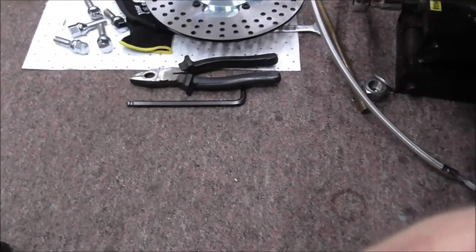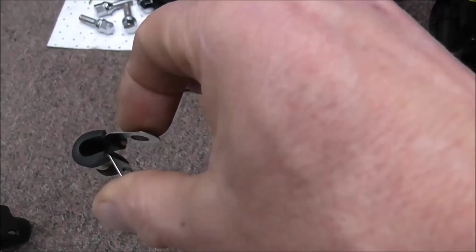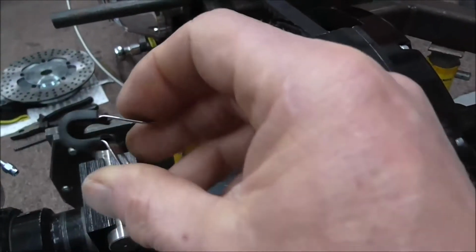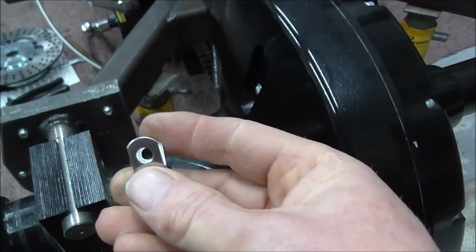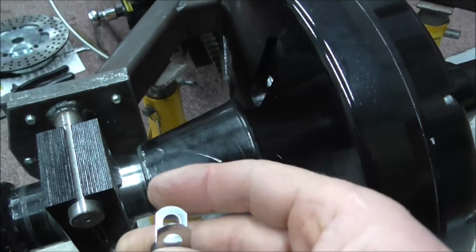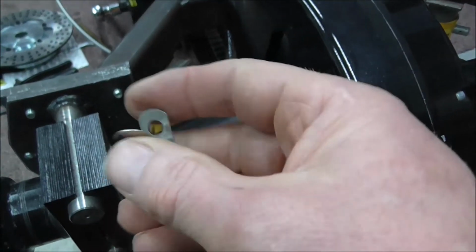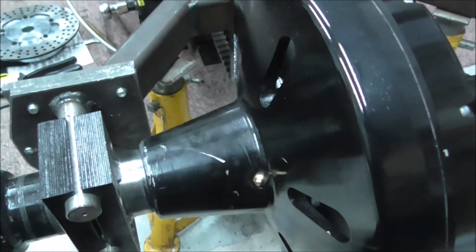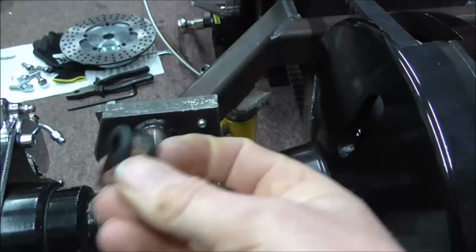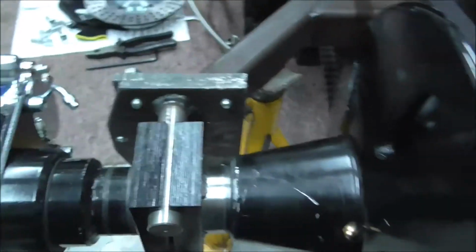And what I'll do is every so often there'll be one of these goes on, it'll be drilled and tapped. This is quite a thick box on this swing arm as well, so I'm drilling a few little holes. I'm only putting M6 holes in, so I'm drilling a 4.8mm hole and tapping it out to M6. So it won't affect the structure of it, but there'll be a few of these clamps running round, holding all the brake lines in place.